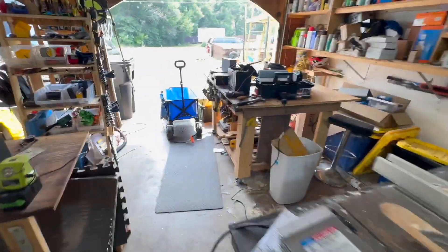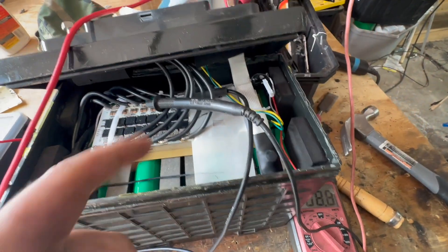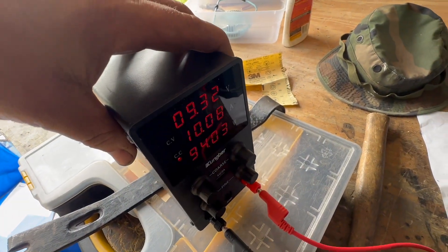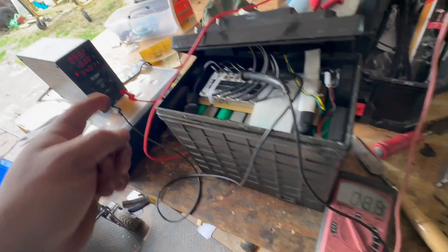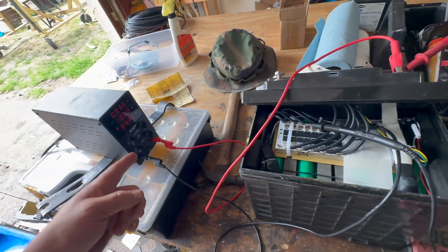Here's how I'm trying to recover the second one — I've got an alligator clip in there, throwing 10 amps at it. We're up to nine volts; measuring at the terminals we're actually at 8.8 due to line loss. I initially told the customer I didn't think we'd be able to save them, so I messaged him this morning saying they started working. He may have batteries on order already — the point may be moot — but either way I'll offer them to him for basically the time I have into it.